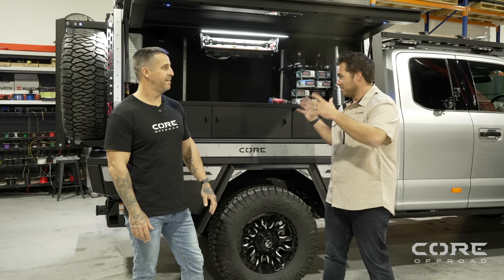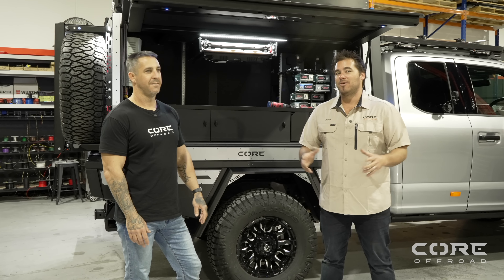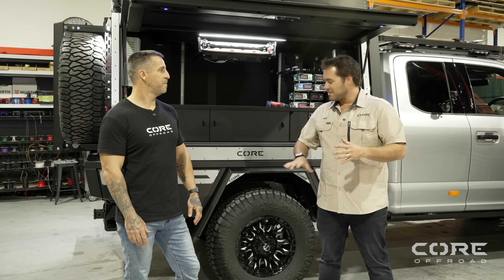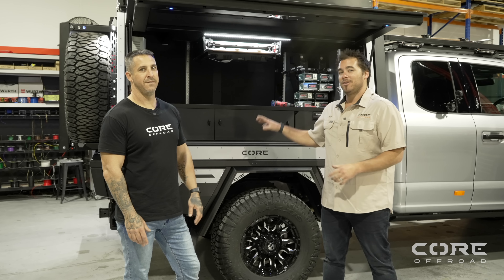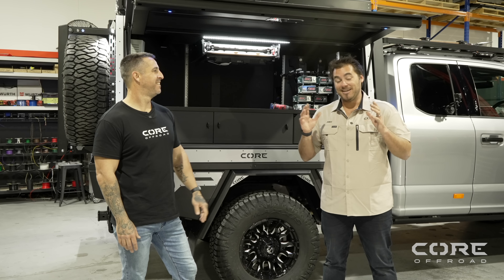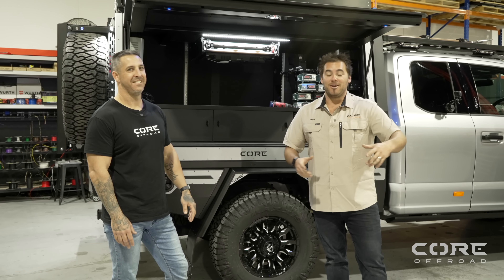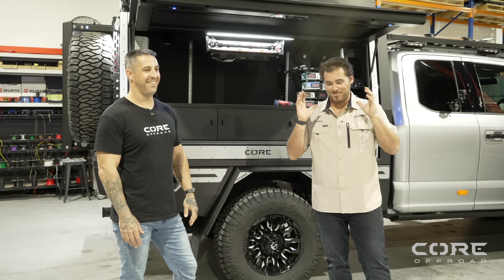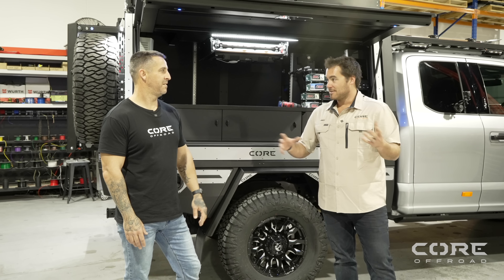Personally, I'm not the type of person that would take a canopy off — I've had one on my vehicle since 2013 and never once thought I wish I could take this thing off. There are some downsides, and we may do another video on the lift-off side of things. This vehicle is a prime example: we've got a leaf-sprung rear end that needs a suspension spec to carry the constant load of the canopy. When you take that canopy off, it's going to be rock solid and stiff in the rear — you're honestly going to probably need a mouth guard and a kidney belt.